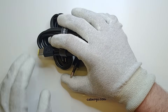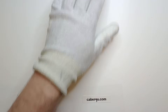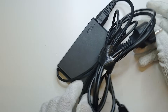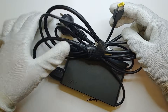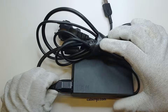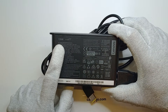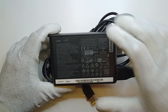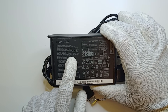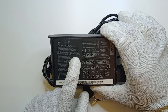Let's start with the story of how I came to this. The laptop I'm normally using has a 135W power supply with a regular socket and laptop charging port output. On the back it says 135W, and those 135W are achieved by providing an output of 20V at a maximum output current of 6.75A.